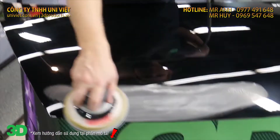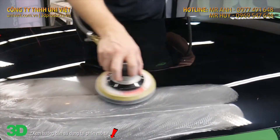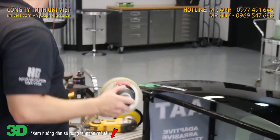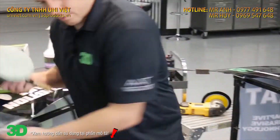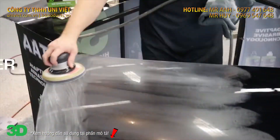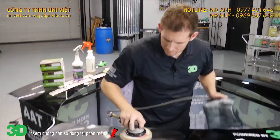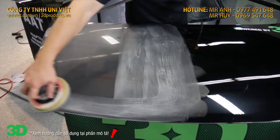Using nice even back and forth motions, making sure you don't collect too much dust, because what can happen is you can actually grab some pigtails. You can see how well the AAT paper is working by how much sanding dust is there and how quickly it's cutting through it. Remove some of that dust so you don't get any more pigtails. It cuts nice and fast — do a second quick pass just to make sure it continues to give you a nice even sanding motion.